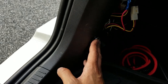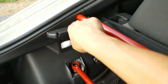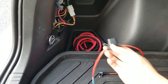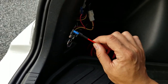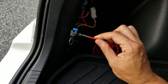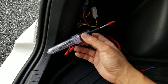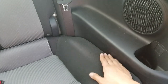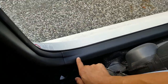Now that the ground is firmly mounted, all that's left is to connect the power. I'm going to use the supplied wire and run it underneath the trim and then down along the side of the trim to the front, under the dash. But instead of going through the firewall and connecting to the battery, I'm going to tap into the fuse box under the dash using a microblade fuse tap. I've got a 15-amp fuse already installed — I just need to find an open slot and plug it in. I want a slot that's always on to mimic hooking it up directly to the battery. The easiest way to find one is to use a test light. First I need access to the bottom edge of this trim to slide the wire underneath and run it toward the trunk.